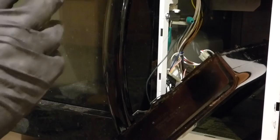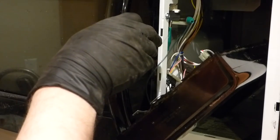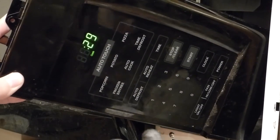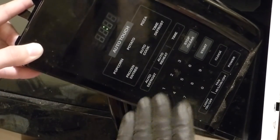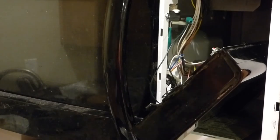I decided to share that turntable spinning behavior in case anybody else runs into it and gets confused. If I jump this and turn the microwave on, the transformer turns on — you can hear that hum. I'm going to put a glass of water in there just to test with it. And the water got hotter, so that's the problem — that switch isn't working. The manufacturer should have made it throw some sort of error if the switch is bad, instead of just turning on and making the fan go with no heating. That's really confusing. If something's going to fail, give me an error or blink something so I can look it up in the manual. But that's how I troubleshot it and that's how I'm going to fix it — just replacing that switch. Thanks for watching.